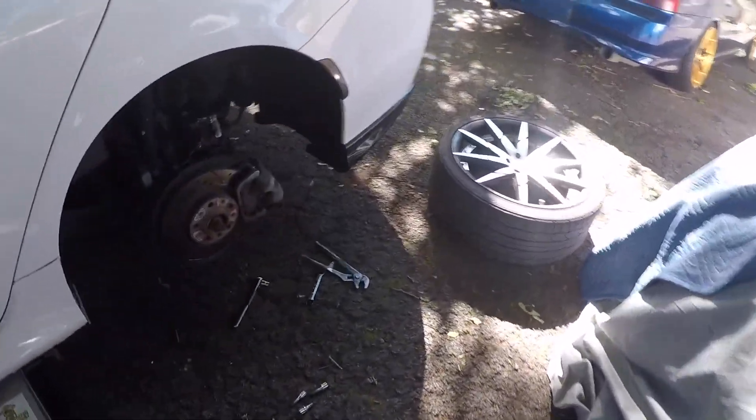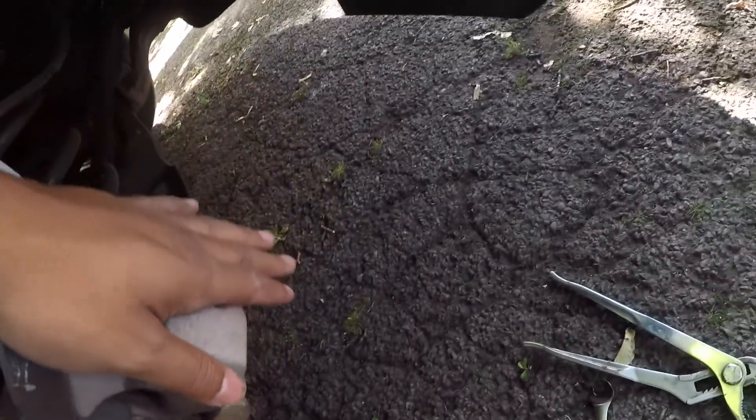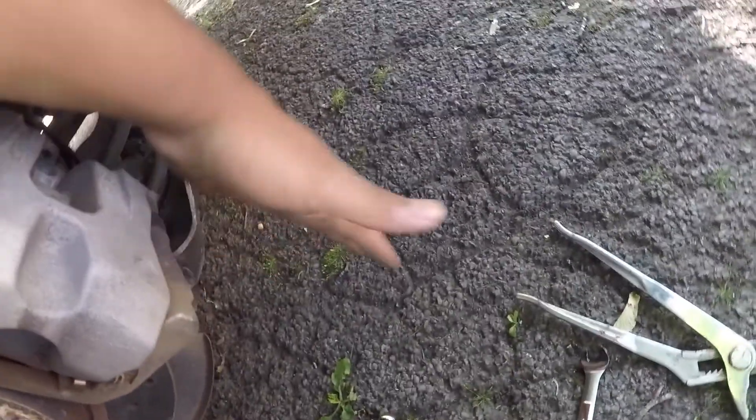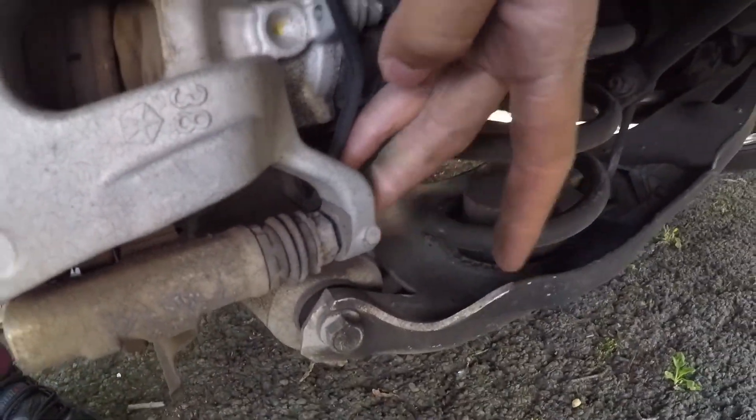The lock screws are so corroded in there, we can't get them out. We had to get a drill bit. He's still working on the front, but I got the back out so far. I got that screw out — not the rotor, I'm talking about the caliper. There's a bolt right here — a 10 millimeter bolt — you get it loose, then you can just open this up and get to the brakes like that.